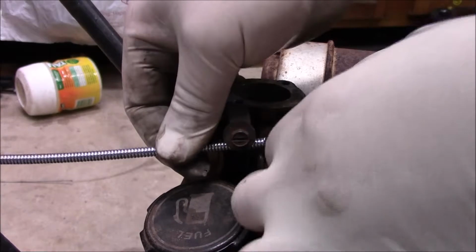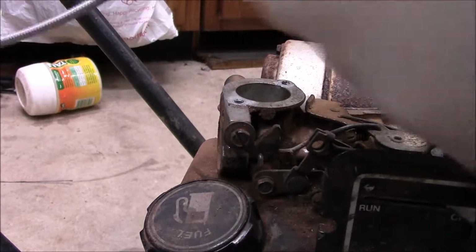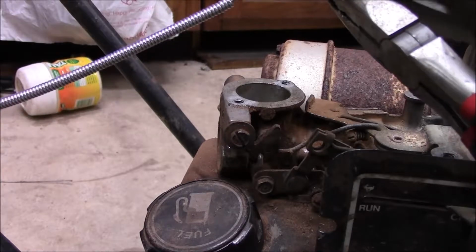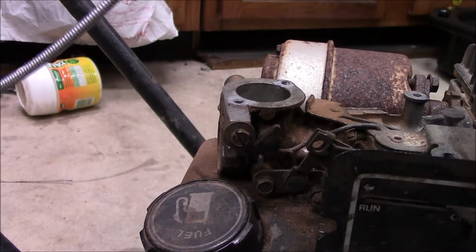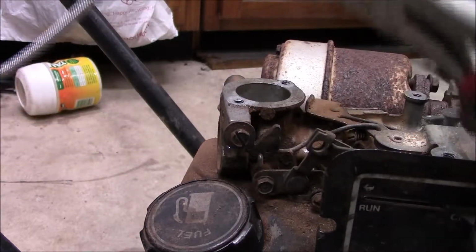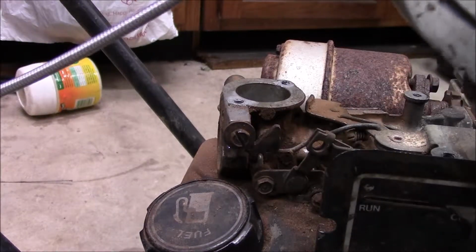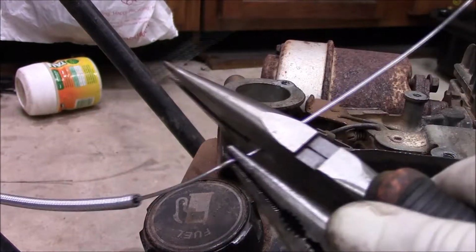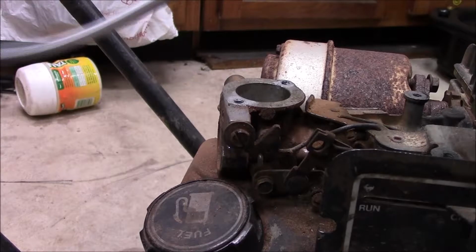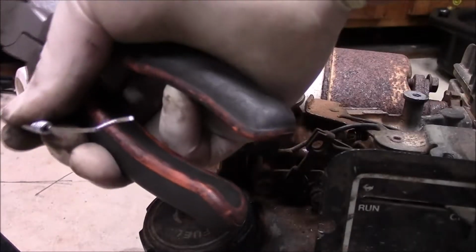So let's try to make the Z, and all you need is two pair of pliers. So I'm just going to put one right there, and then I'm going to take the other plier and just bend it 90 degrees, like so, and then I'm going to put the other plier back right here. And we're going to bend it over, another 90 degrees. Okay, I don't know if you can see that. And then I'm going to cut that off where I think it meets, right about here. Okay, and so we're going to finish the Z. You can make nice little tools for this, but if you don't have one readily available, then this is what you got. And when you're done, you should end up with a Z like that.